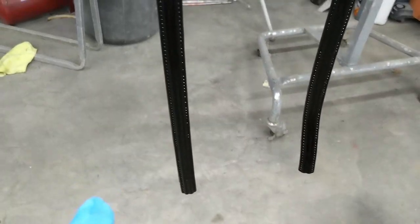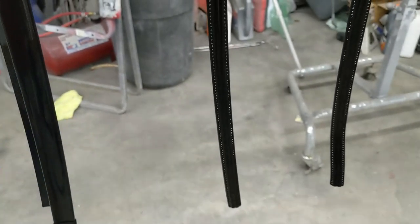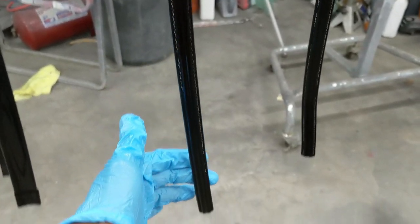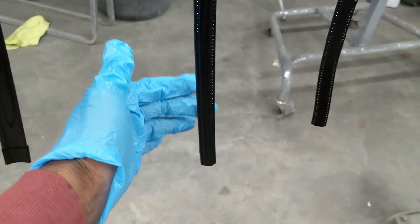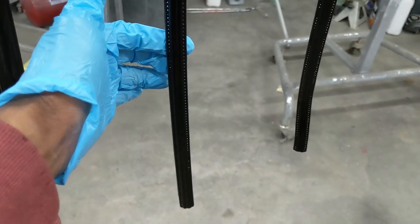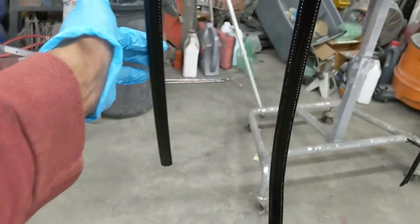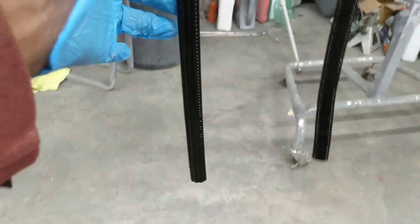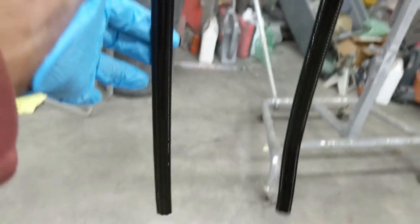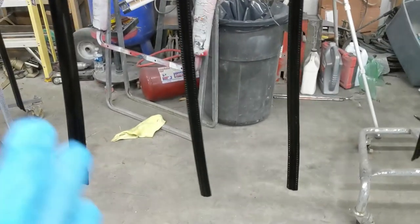Now, part of the reason for all these sags, and the tip so that you don't have this issue, is that I hung these up, which is kind of how you do this. It's how I've seen it done, but they move. So I had my hand behind there, and I'm holding it with the gun, trying to trace my angle down. And if they moved out, I'm trying to chase it over, following the motion, as you can see here with the camera, when it's moving. Inevitably, you're going to have some inconsistency in spray. That's where the issue came from.